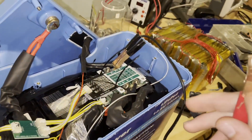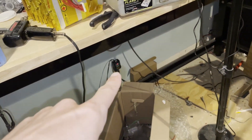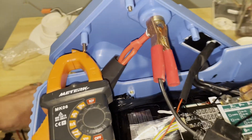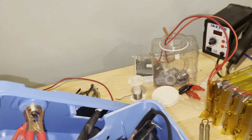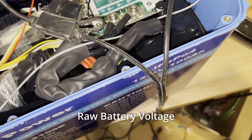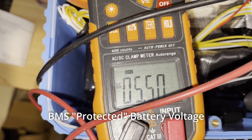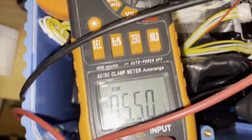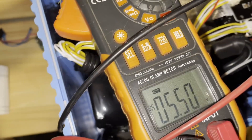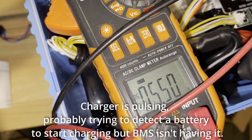I do want to see if this thing will take a charge, so I've got my trickle charger here and I'm going to connect it up. I don't have much hope, but the light turned red, which I think means it's charging — so there's enough voltage for it to detect that it was a low battery. Let's see what we're reading: 5.87 here, 5.5 there. There's still a bit of a discrepancy. That doesn't seem promising.